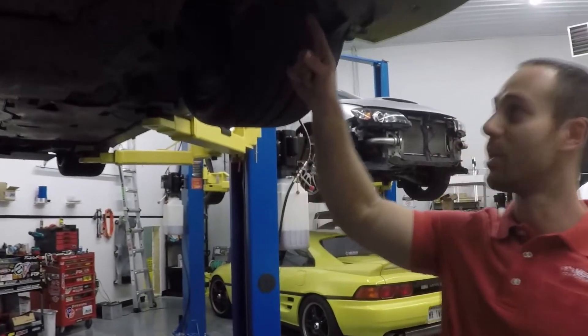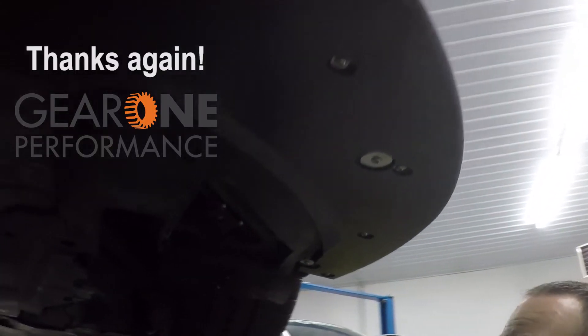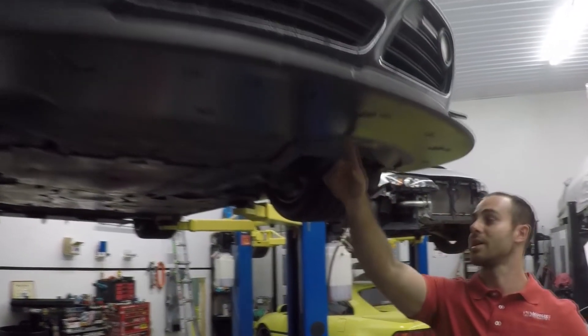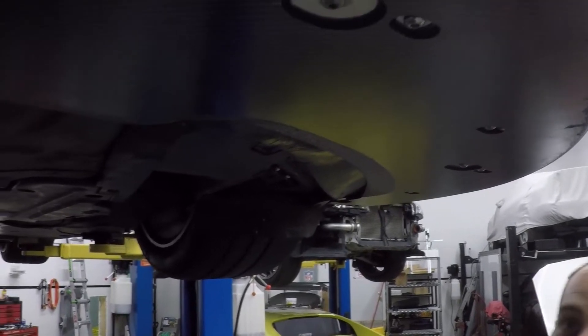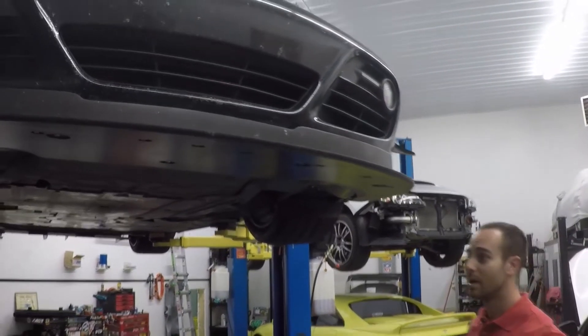As you can see, it is most definitely a development vehicle — we do take it to the track very often. These are actually laser ride height sensors that you see here. We have been working on dialing in the suspension and also using them to validate our aerodynamic forces, so we can actually see that the suspension is compressing at the end of the front stretch — there's one in each corner. Also, this large shallow cut on the front splitter does aid in downforce. Everything we design is done in the name of function, and we then also try to make everything aesthetically pleasing.